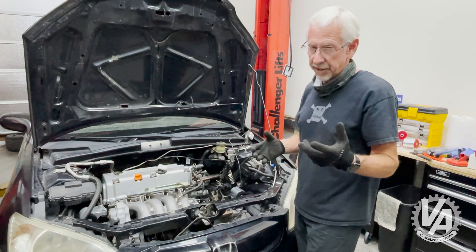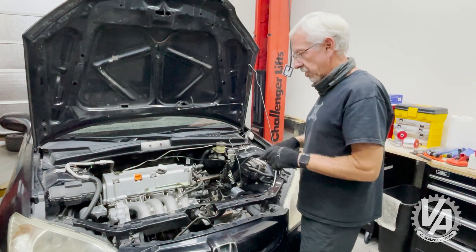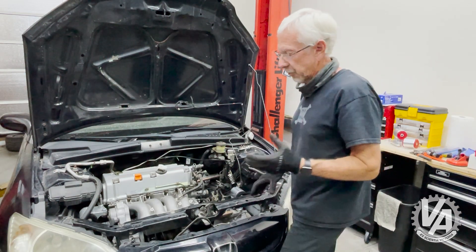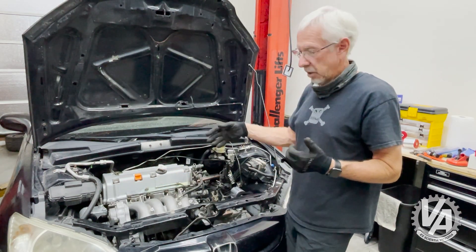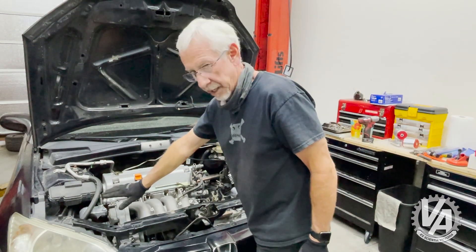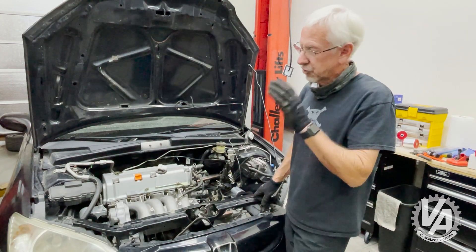Just because it's actually the air fuel ratio sensor that's the only real difference. On some models of EX, they actually have an air fuel ratio sensor as well, but you need to do some changes to the wiring. It works really well in this car. The one thing is these cars come with hydraulic power steering, so if you're going to use hydraulic power steering, you'll want to get the RSX power steering pump, the RSX hose, the reservoir, and then you're going to have to make a little bit of a clearance cut in the hood in order to clear the pulley, because it's going to stick up a little bit high and interfere with the skeleton in the hood.